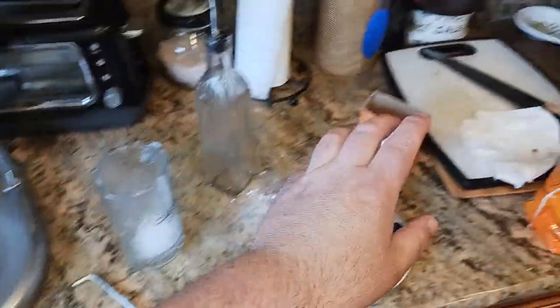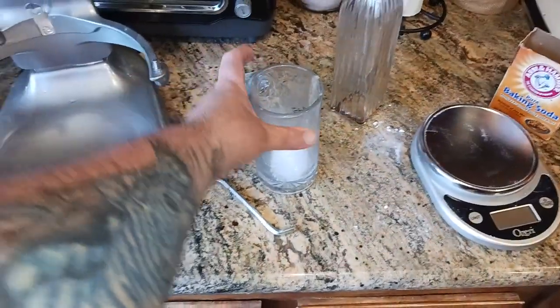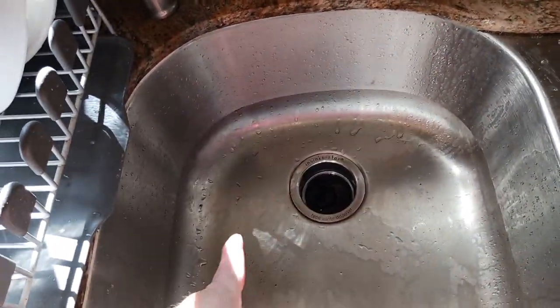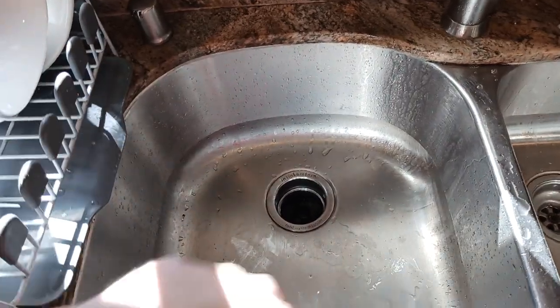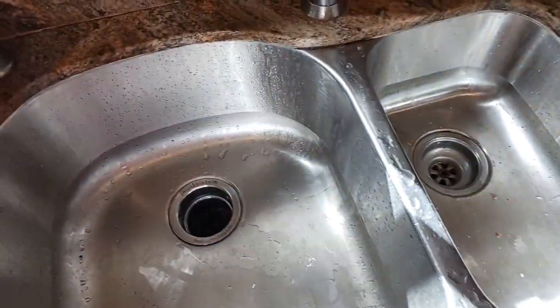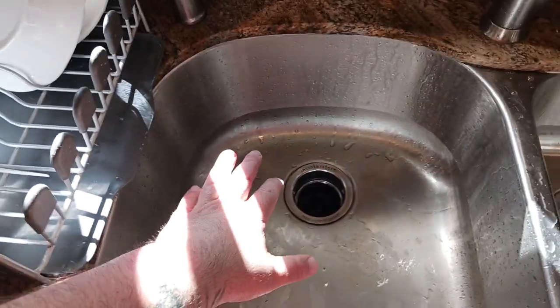I think I might repeat the process again. Since I'm out of ice I'll start over — put baking soda, about a half a pound, into a cup, mix it into a slurry, pour that into the garbage disposal, and then let the baking soda-water mixture sit for about 15 to 30 minutes and run it again with more ice to flush everything out. The smell coming out of here is just horrendous — probably two or three years of built-up gunk.